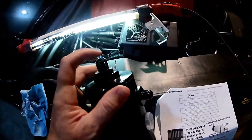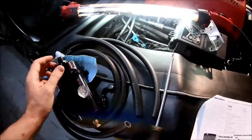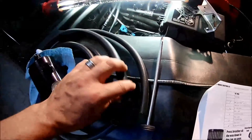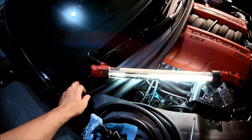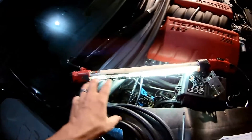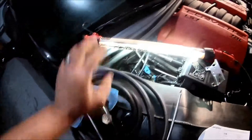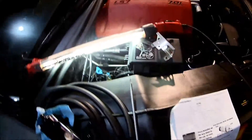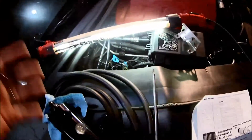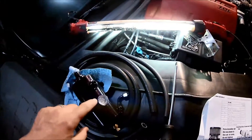This one has an expandable valve, so if pressure gets too great we can use some tubing and route it somewhere safe just in case. They also mention you can route it NASCAR style up to the windshield, so if you have an over-pressurized crankcase situation so much that it overwhelms your system, it'll splash on the windshield indicating you've got a massive problem. We don't plan on beating this car too hard, but it's nice to have insurance for those crankcase pressures.